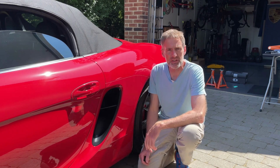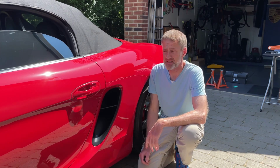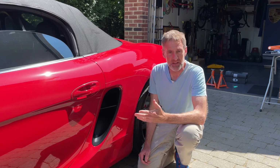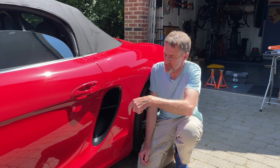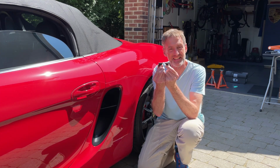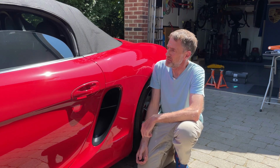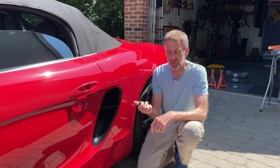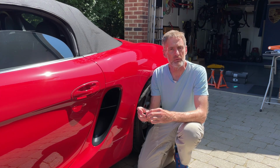Now it's a lovely warm sunny day in the UK, and that made me think about when it rains, and when it rains, what happens to where the water goes on the hood. And there's a bit of a consensus if you hunt around on YouTube that what happens in here can be improved by removing these. These are the little plugs that are supposed to do a job inside here in between the water entering the top and draining out the bottom, but they can get bunged up with dirt, debris, maybe even insects over the lifetime of the car.